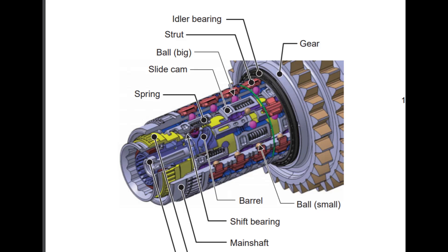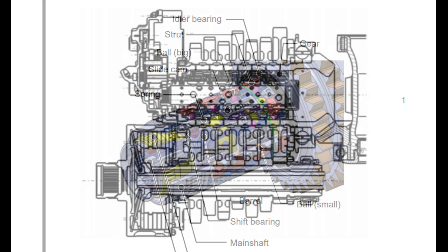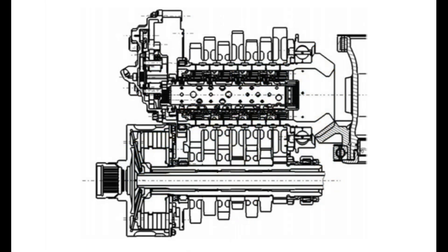The other cool part about that design Honda came up with was that — as you can see there's actually a space between the two gears to allow for the slider — that space wouldn't need to be there. So the gearbox could be much shorter, like 110 millimeters is what I was figuring from the pictures I was looking at. So you're cutting off 60, 70, 80 millimeters of gearbox, which would be significant. So I am curious as to why they went with this particular design.